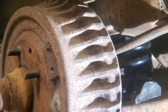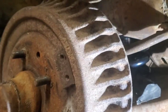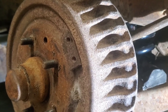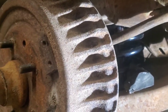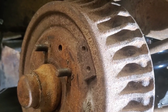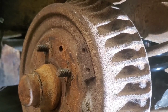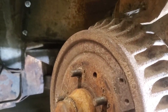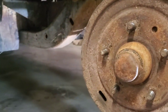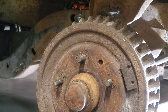Just in case there's anybody out there that hasn't built one of these trucks and is thinking about maybe doing one of these conversions — this is an earlier front steer subframe, which is found on '67 to '69 Camaros and Firebirds. It's also the same one used in the '68 to '74 Novas, Buick Apollos, Pontiac Phoenix I believe, and I think there might even be an Oldsmobile that had the same subframe. So there's quite a few of them out there. This is the first one I've done with that particular subframe, and the downfall is most of them have drum brakes.